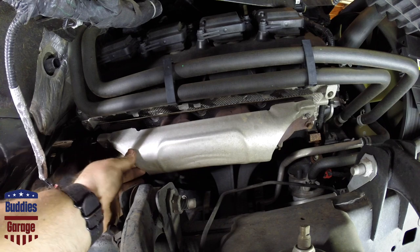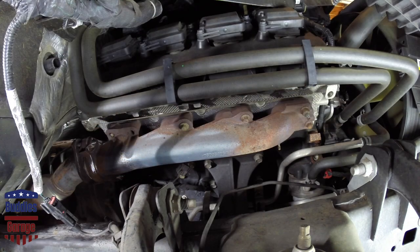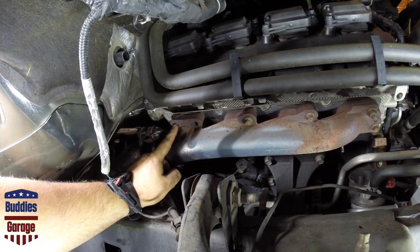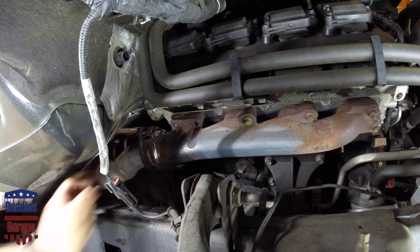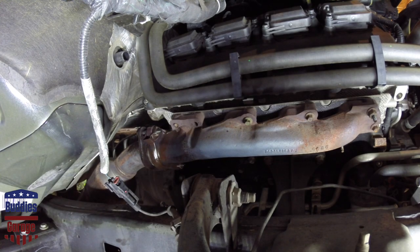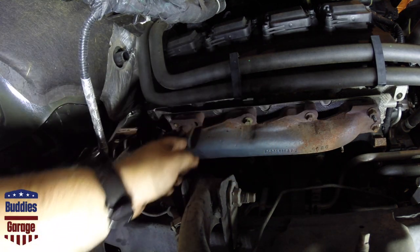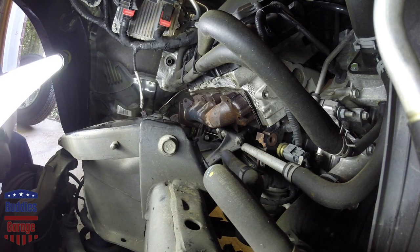Four 10-millimeters in the corners — I only had to take three because lucky me, I got a broken bolt. It looks like it broke off flush with the manifold, so I might get lucky on extraction. Still letting these 14-mil bolts soak because they are tight and do not want to come loose. Start going around with hand tools, and if they're tight just move to another one, because what these cast iron manifolds do is warp — that's what broke this bolt. Time check 8:53 and she is finally loose.